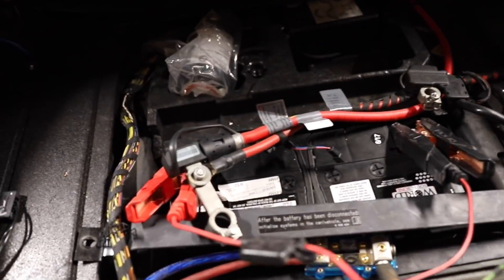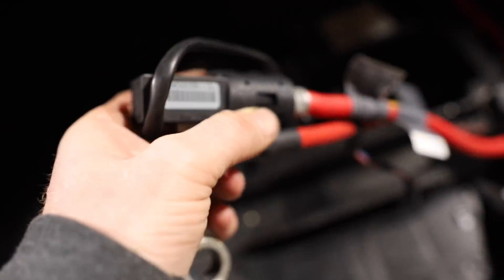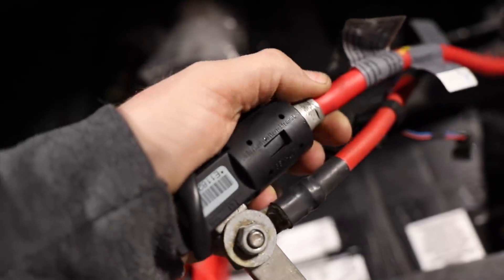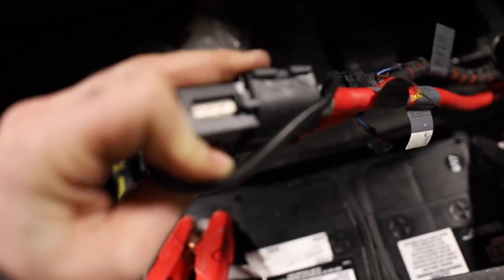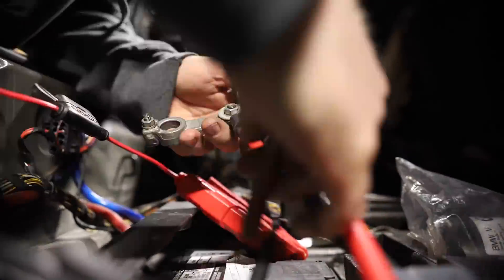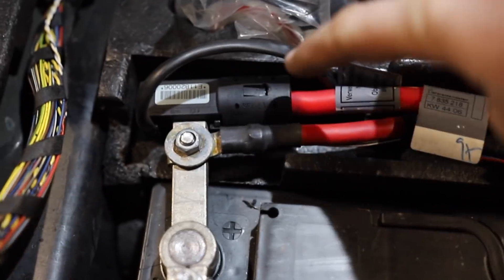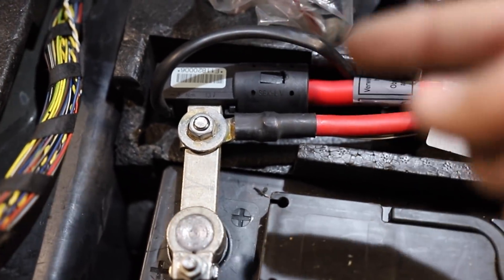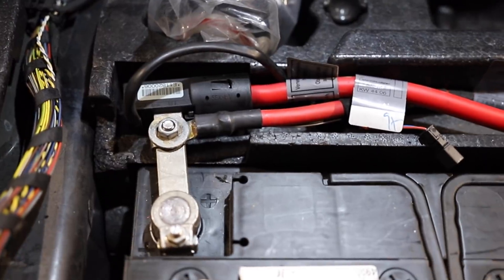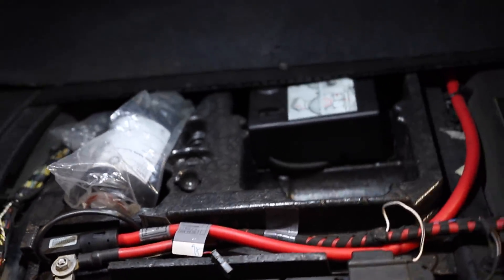So I'm going to try and start the car. I'm going to go ahead and bolt this whole thing up. What I'm seeing right here is there's this little piece of plastic that's like pushed down, and then this cable is really loose right here. I'm going to go ahead and take it apart right now and see what we can find out. I didn't even have to actually go as far as trying to take the whole thing apart. What I did was I just flipped up this tab here so I could insert the wire back into where it came from before it got exploded out. I didn't want to spend a lot of time on a solid fix because this is all going to be rewired for the long run when it goes into the new car, since that wire will be like three feet too long anyway. So everything's tightened down, everything's good here. It's time for the moment of truth — we've got to go up front and try and start this car.